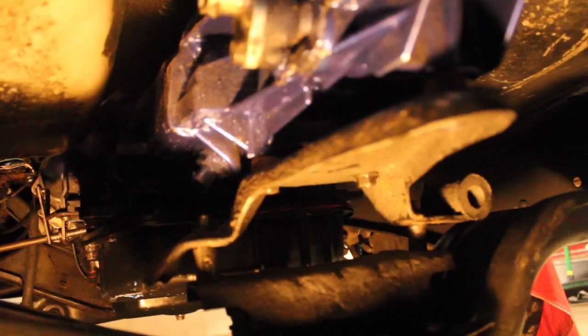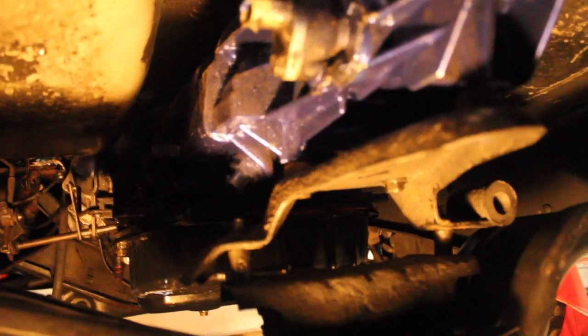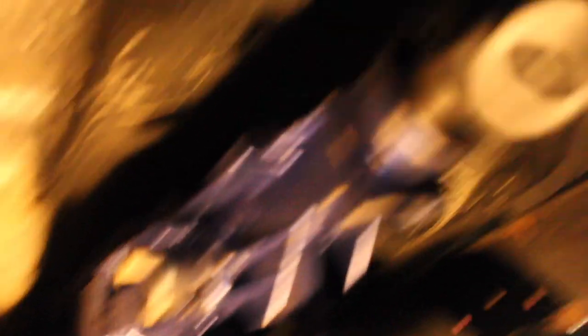What I used for the spacers was just gas pipe — it's the same as any steel spacer you can buy. I used a one-inch steel spacer, cut it to one inch on each side. This makes it sit at the complete factory tilt — no worries about angle or anything. The driveshaft bolts up in the exact same location.